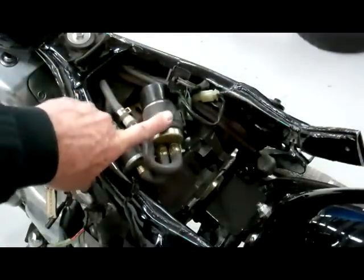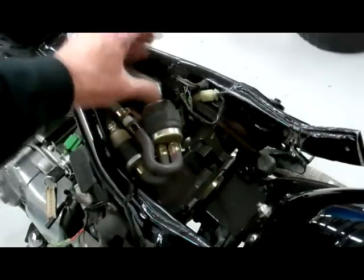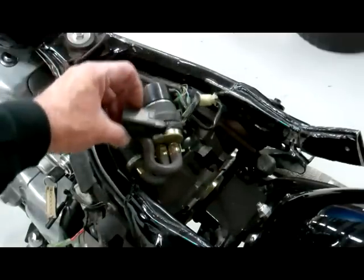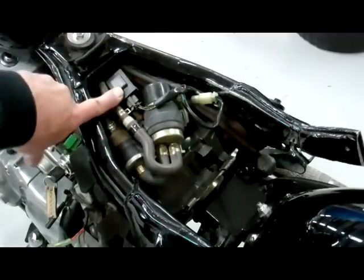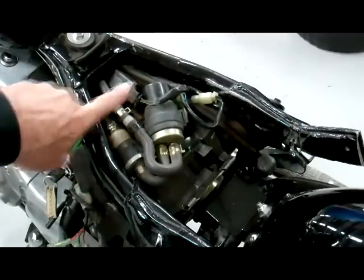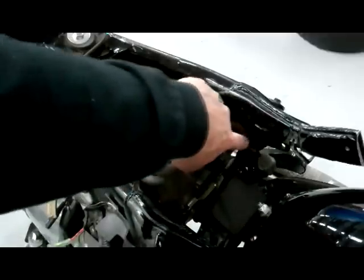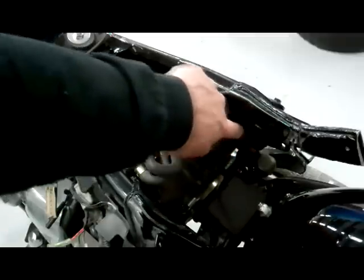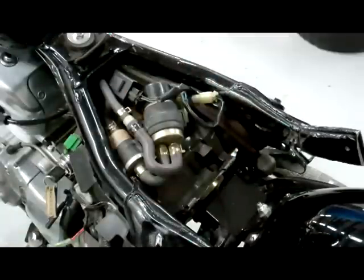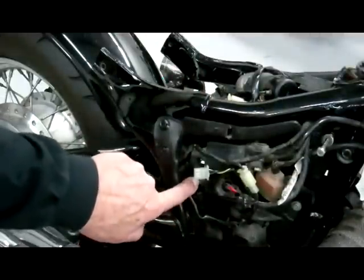You can see how I've rotated the pump up and out of the way from this bracket. Then we're going to take the flasher — this is the flasher here with the shorter wire — and just tuck it in here. I'll wire tie that. There's also another relay with a longer wire — I ran that wire down through the opening next to these hoses and into the side compartment.